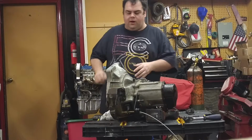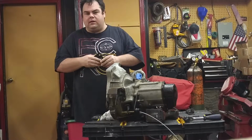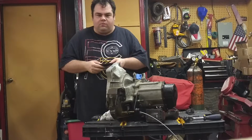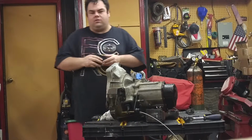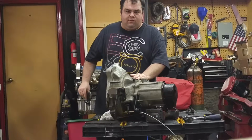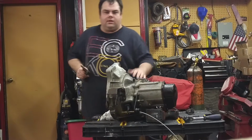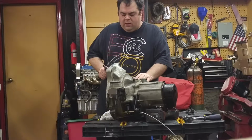I want to talk to you guys about a product that the Festiva store is offering and go over the importance of why this is a product that a lot of people should look into and consider purchasing for a future upgrade when you're building your Festiva. What this is basically, it's a hydraulic cable clutch adapter. So this is going to allow you to take a modern Mazda G-25 transmission and, by using this plate, convert it to a clutch cable driven system that is in the existing Ford Festiva, Capri XR2s, and the Mazda 323 GT.